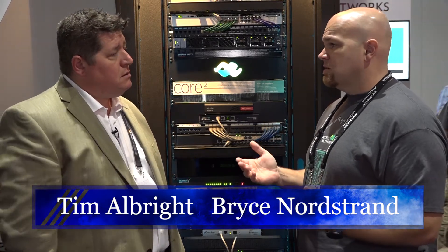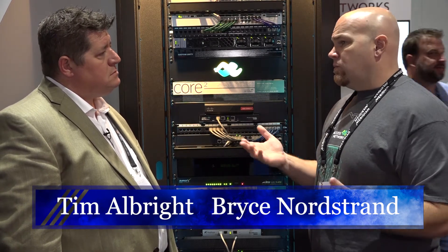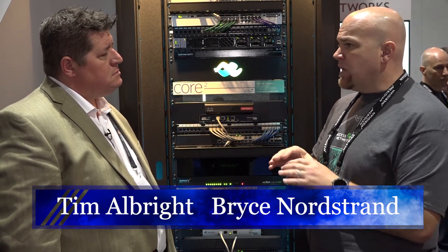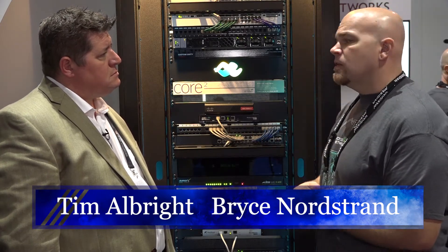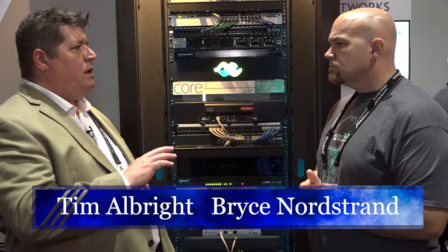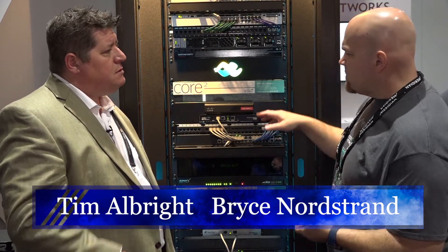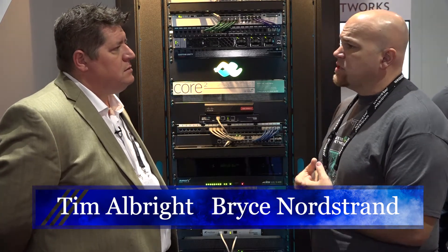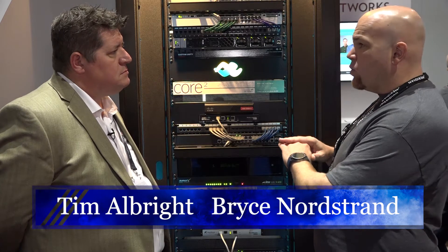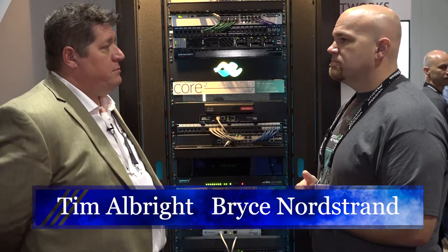It's in the software and licensing. The hardware itself remains the same, so if we send out a flat network and need to go to multiple VLANs, we don't have to send out any additional gear. In the Cisco world that's unheard of — you have to go from a 2960 Catalyst to a 3500-series Catalyst, which is a very expensive proposition. We also do layer 3 at the switch level, not router-on-a-stick like some other brands. If a dealer gets out in the field and realizes they need VLANs, we remote in and handle that — it's all done remote.